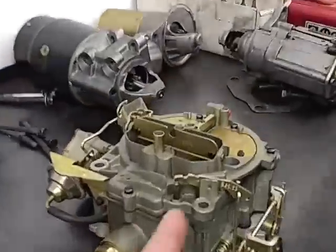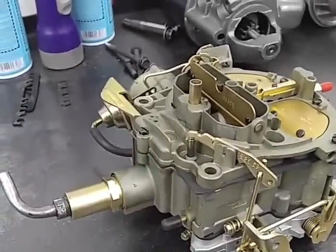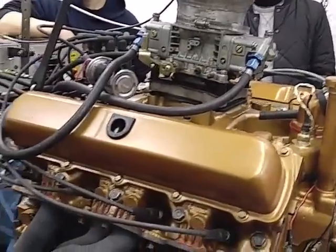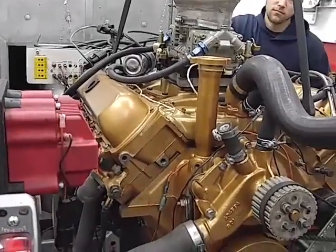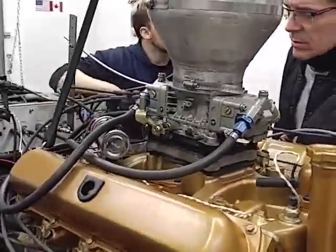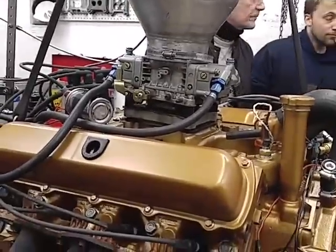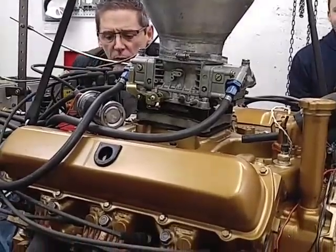So this is an original 650 CFM, rebuilt, numbers matching for a 70 Rallye 350, 310 horsepower, which this exceeds by a genuine, real, gross horsepower. Last year for gross horsepower was 1970. In 71, they went with hardened valve seats for unleaded, low-leaded fuel, net ratings, which included the alternator, power steering pump, torque converter if it had an automatic, clutch assembly if it had a manual. So the horsepower dropped because the compression ratio went down, but it also dropped because they were using net ratings. So you had two things figuring against your horsepower in 71 versus 70.